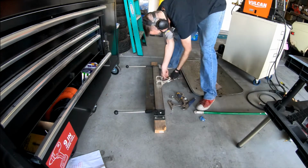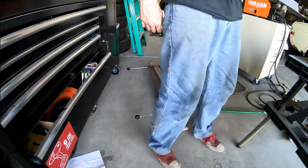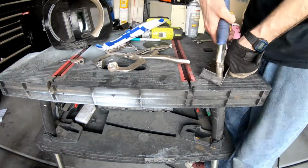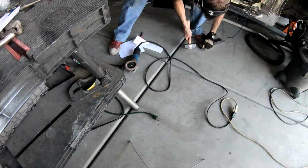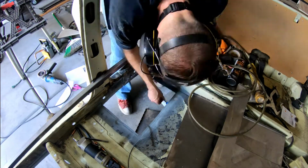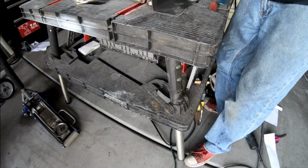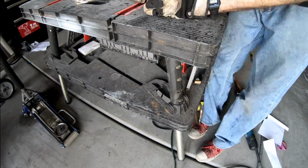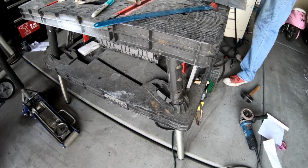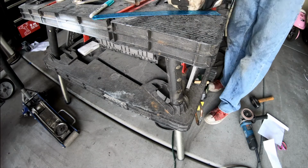This works out really pretty well, and I actually would still, especially if you can mount it to a solid surface, I would strongly suggest anyone getting this metal brake from Harbor Freight, as it does a good job and allows you to really put parts in the shape that they need to be put in. Once I got that done, I went ahead and drilled the holes to weld this piece in and started adding it to the rear deck tray.